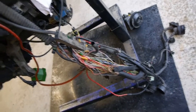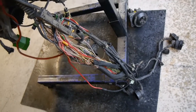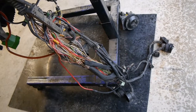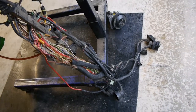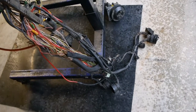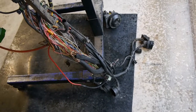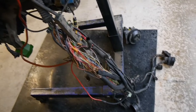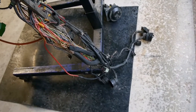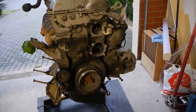The next thing is this mess of wires. This is an auto engine harness going into a manual car, so I need to get rid of the auto wiring. There's quite a bit — they have a separate computer with a plug similar to the ECU's plug, and an extra X20 plug similar to the body loom. A lot of wires go directly from the transmission computer to that extra X20 plug. However, there are three wires which connect the DME with the auto computer, and I'm not 100% sure how to handle those. The rest I can just cut out, but those three I'll need to look into further — possibly leave them accessible in case the car doesn't start.